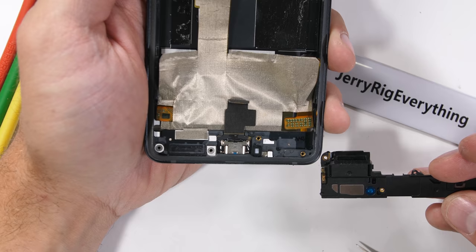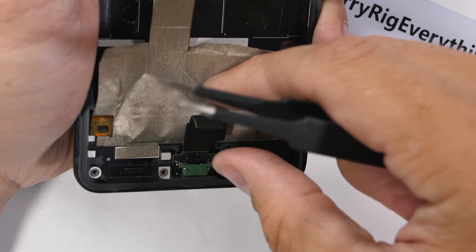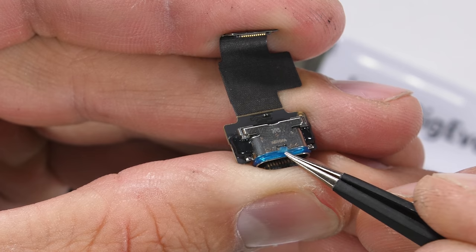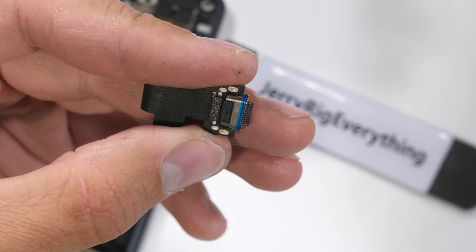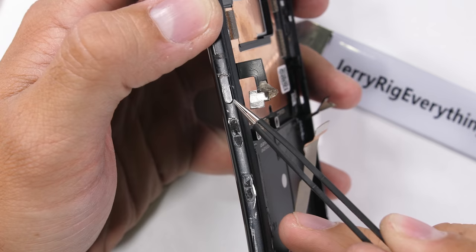The loudspeaker comes out next — this is one of the 2 stereo speakers; HTC counts the earpiece as the second one. It has the same gold contact pads on the back for communicating with the phone. And finally the charging port — a super tiny little guy with a blue rubber ring around the tip to help with that IP68 water resistance rating inside of the phone. It's fun that HTC has accessorized their internal coloring with the blueness of the back glass panel.